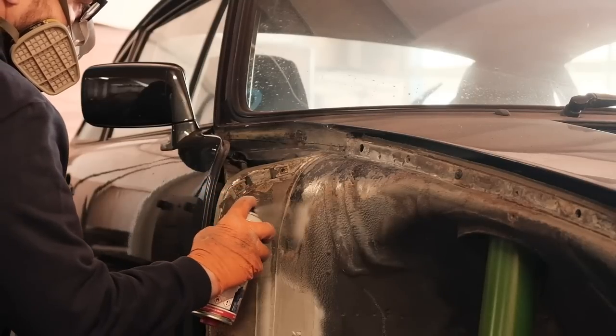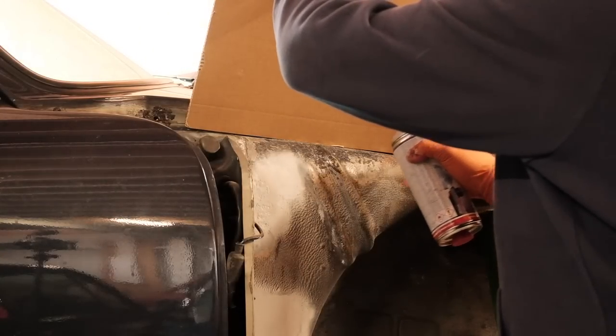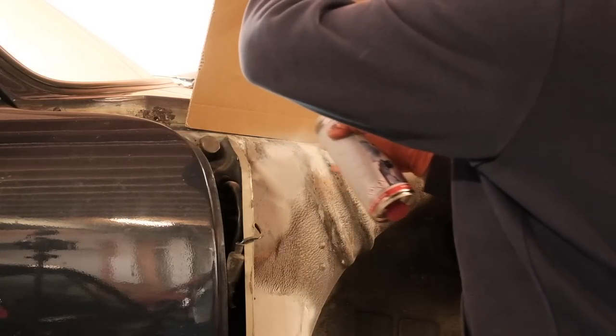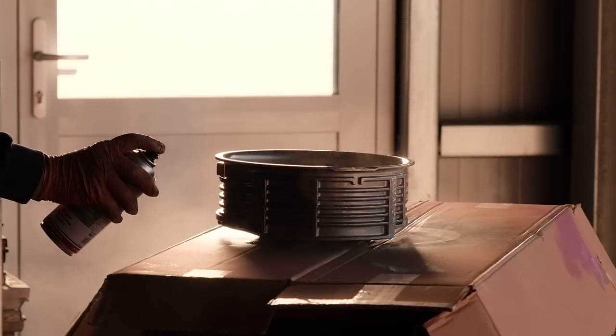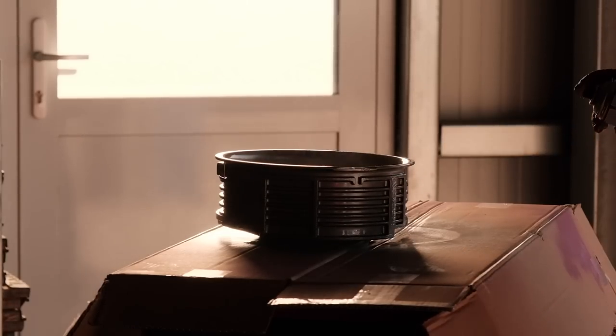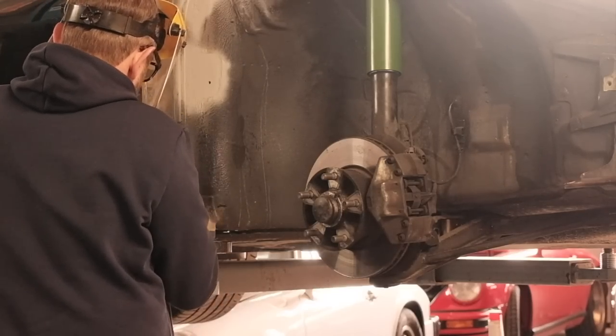And yes, this is some of it. It's one of those rattle cans that contain both the primer and the hardener. You break a membrane and they mix up. I bought it to paint a fan and didn't want my customer to find pink primer bleeding through when the blades get their chips, and so I used up the rest on the fender project.